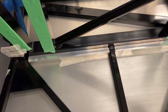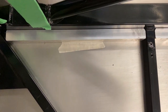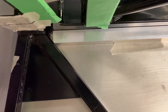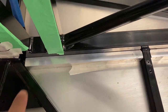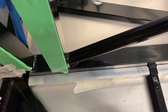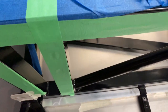Here's a perfect case in point where using a power tool versus a hand file is less desirable. These are just the radiator panel support brackets and I need clearance around the welds — you can see it's a very close chamfer on either end. The difference is that with a power tool you can very easily take off too much, whereas with a hand file you can develop a bit of a press fit. The instruction manual says to tape those in place before drilling the rivet line, but if they're actually press fit and held in by the chassis, so much the better — that's actually pretty solidly in there at the moment.